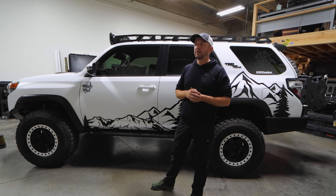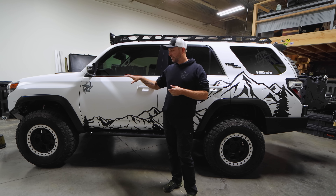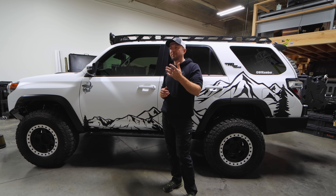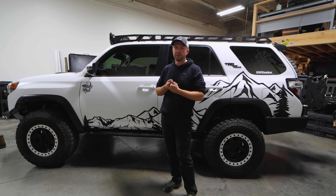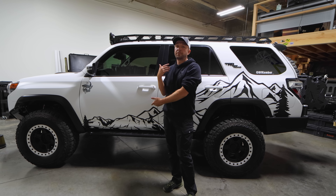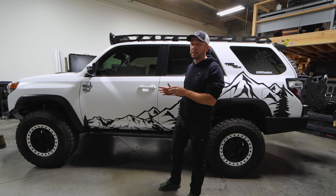As for beadlocks — I never had non-beadlock wheels on an off-road vehicle, but I didn't want to put beadlocks on the green 4Runner at first. Running 16 to 17 PSI in the desert, I kept getting leaks where sand would get in between the tire and the rim causing slow leaks. Out of the first three or four desert trips, it happened twice. I realized either I keep PSI higher — which I don't want — or I go to beadlocks. I went to beadlocks.